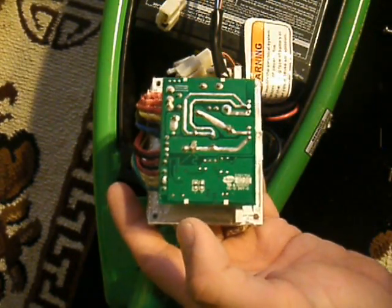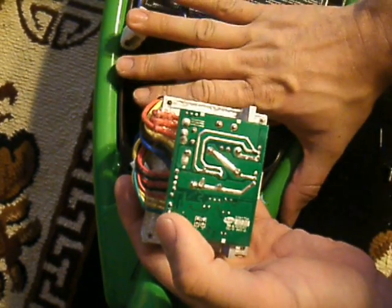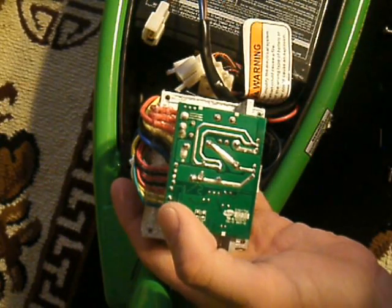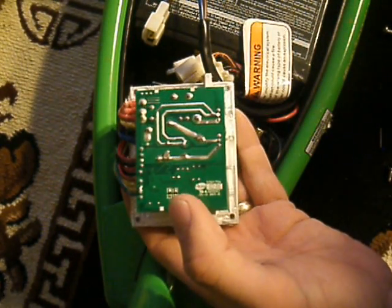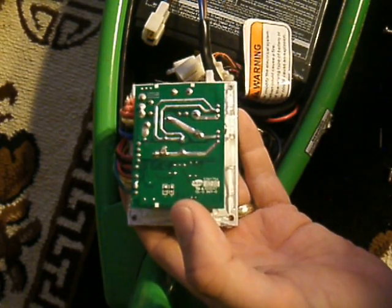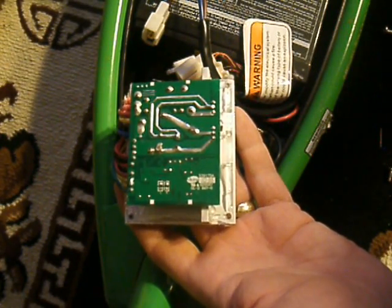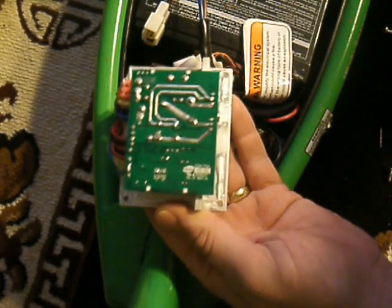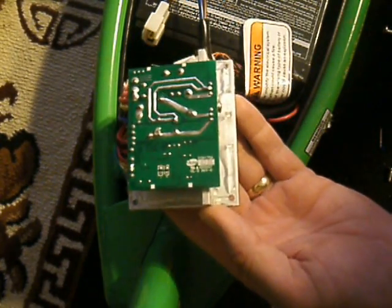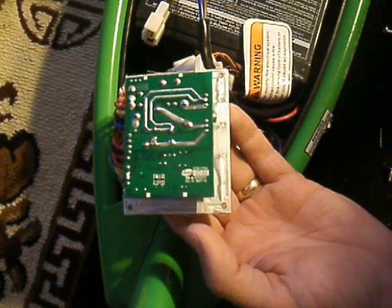And that's how you do it. Put everything back together and give your scooter a try. You can always connect everything, get back inside here, and try it out — see if you can notice a difference. A good way to test it is going up a hill at full battery with your weight — adult weight — and seeing how fast you go up it. Once you've done this, you should be able to go back and notice a big, significant improvement in torque and speed. If you guys appreciate it, I'd appreciate the like — don't forget to subscribe. All that good stuff. Thanks.